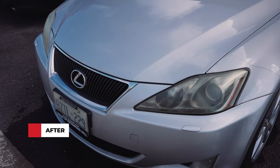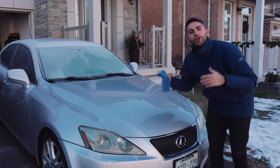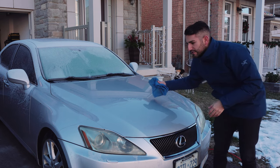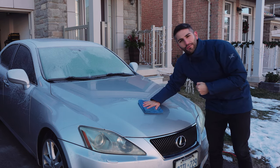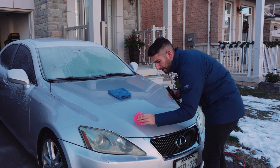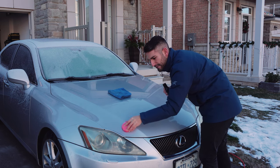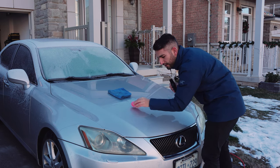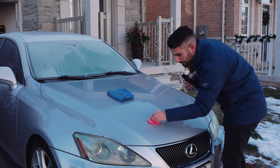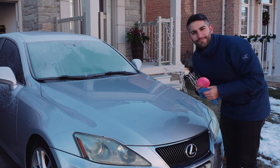Now the last step is to protect the finish. We're going to put a wax on here — you could also use a ceramic coating, but I don't have one handy so I'm using Meguiar's Gold Class wax. I'm going to apply it here and come up toward the edge, making sure I don't push wax deep into the edges of the paint protection film. The wax right along the edge is going to help keep dirt and build-up from accumulating on the edge of the film. Leave it on for about 20 minutes, buff it off, and you're done.